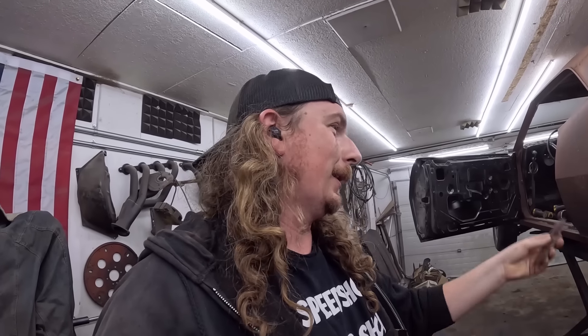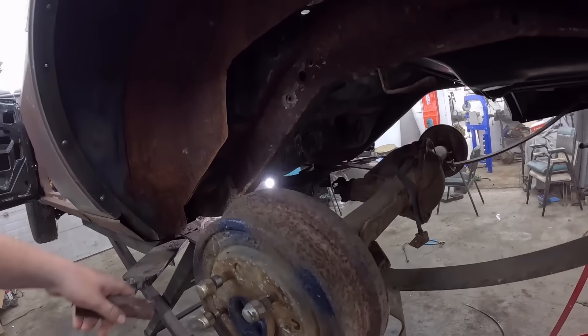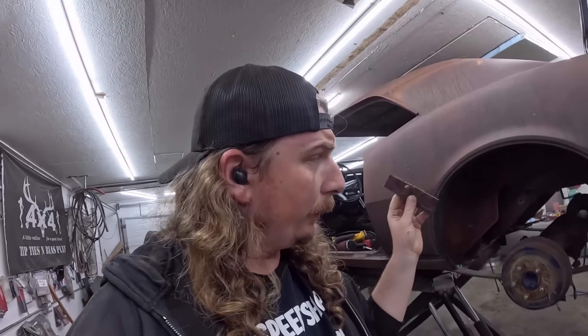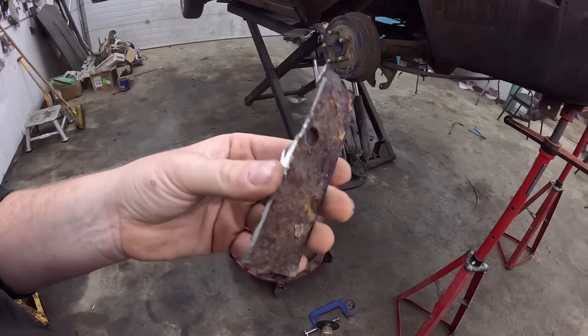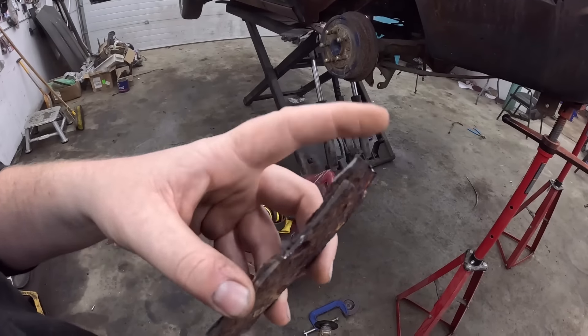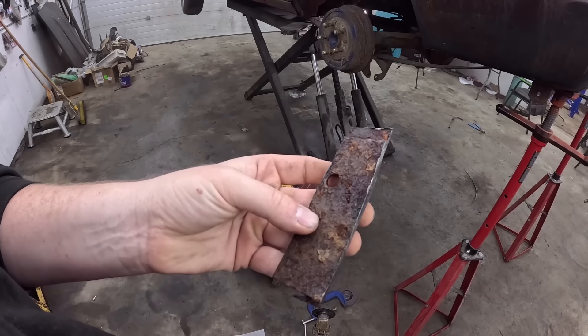Where's it end? If you want this car to be perfect, it needs a frame rail. But it's had the back piece put in, it's had the front piece scabbed together. How much original sheet metal do you want? Everything else is kind of in there. A little ugly. I'll get this cut out on the table — also known as the zip disc on my knee. You know what it is? It looks like it's a double wall just in this one section, right where the pad is, and it just goes back to regular sheet metal. Anyway, just like this we'll have a new piece, and we'll get welding it in.